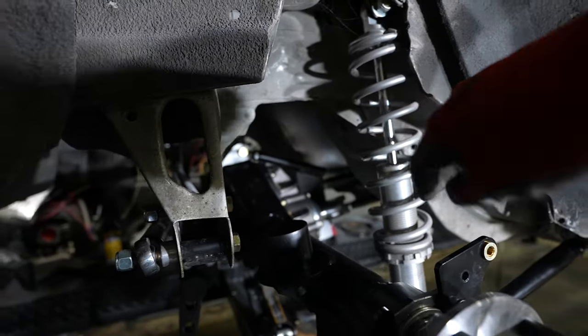The same 3/8 nuts that went on there only got torqued to like 35. So I did some research — it's not the caliper bracket bolts that go to that spec, that's what actually goes to the caliper. It's like the bearing axle retaining plate T-bolts. So 27 to 35 is what I came up with on that. I'm going to go one round at 25, one round at 35, and we should be good.